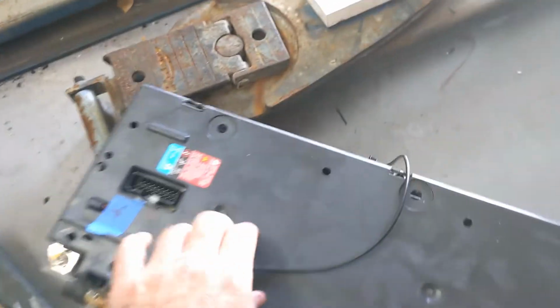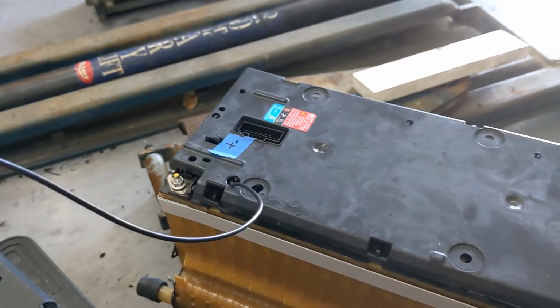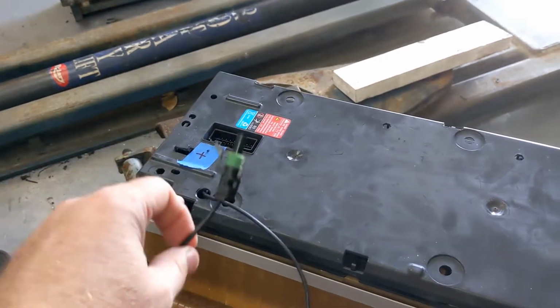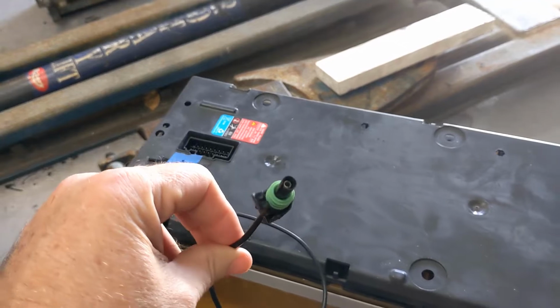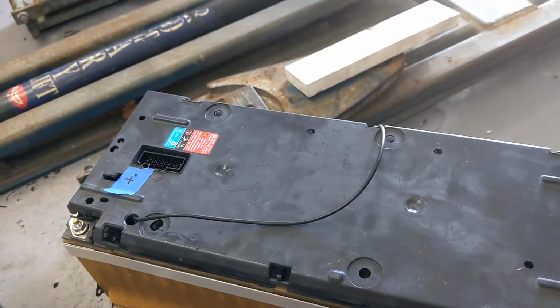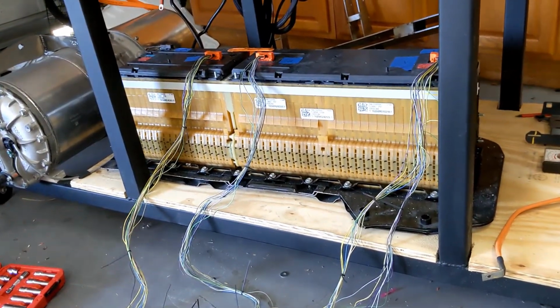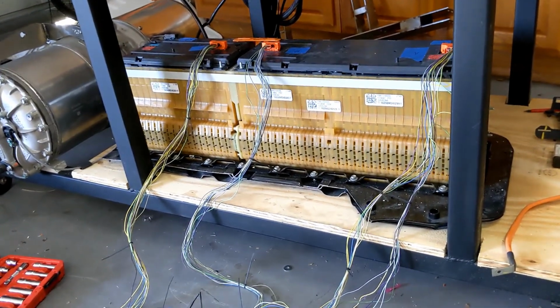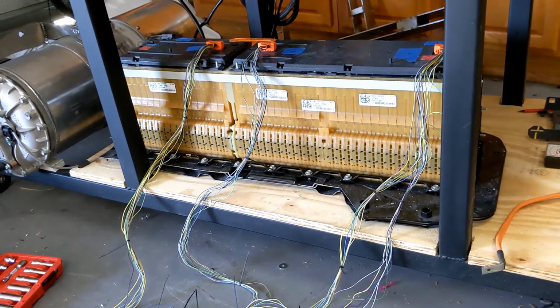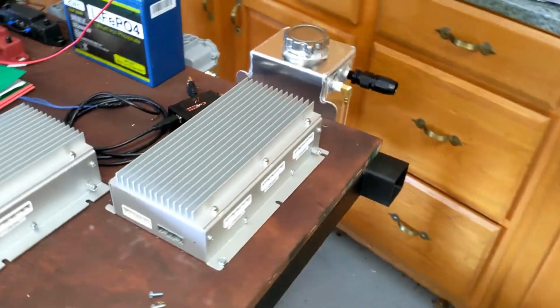what might be best called a tap. And so I've got one here, I'll take the cover off in a minute, where we actually had to tap into here to create a negative lead. So I'm going to cover all that in detail so that you'll understand why it took me a while to understand those 3 components of setting up the BMS. And again, this is just going to be on the cell tap side. But once I wrapped my head around those 3 oddities, the rest of it is pretty straightforward.